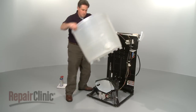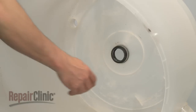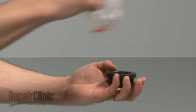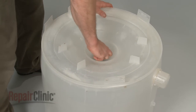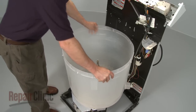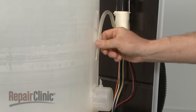You may need to use some lubricant to successfully remove the tub. Once the outer tub is removed, set it on its side. You're now ready to replace the tub seal. If still intact, remove the old seal. To install the new tub seal, turn the tub upside down and push the seal in until it snaps into place. Slide the outer tub back onto the mounting stem assembly, secure the drain hose to the tub port, and connect the water level pressure switch tube.